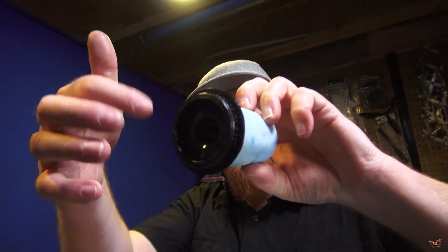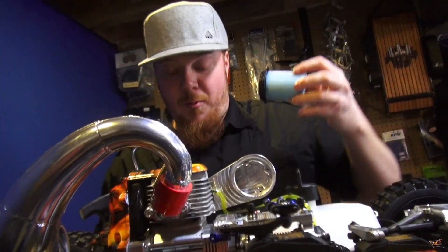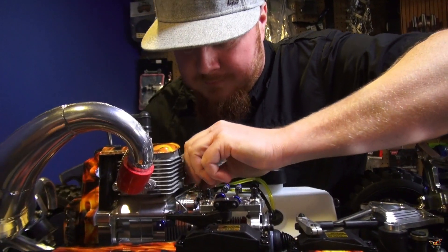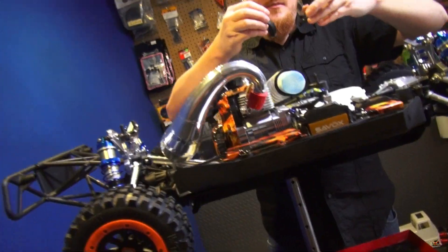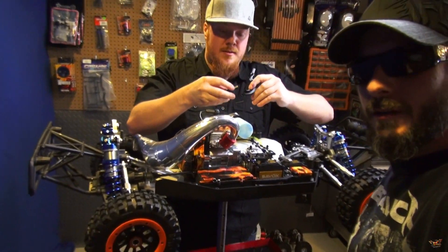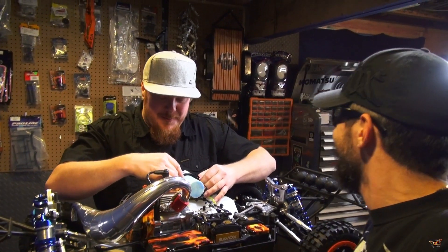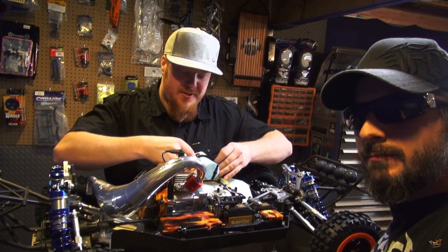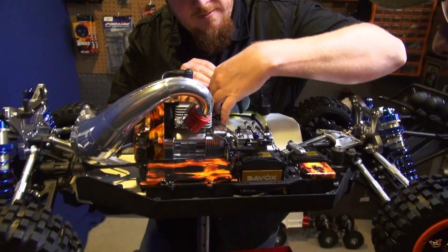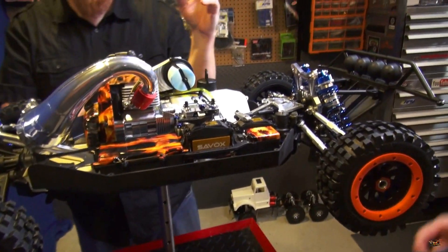We just greased around here — it's a bit messy because we pulled it off, but it was really neat the first time. We took this off to get the final piece of throttle linkage in. The filter system is not the stock one — it's the Baja air filter assembly that goes with the Turtle Racing box system. It's one of the better ones for keeping dust and dirt out of your engine. Snaps together very nicely.